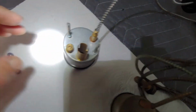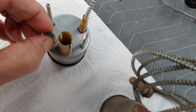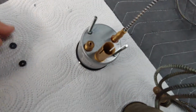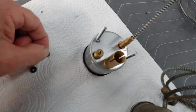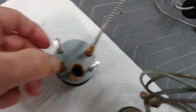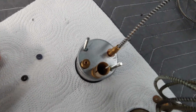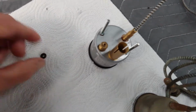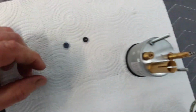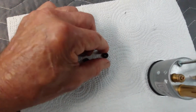So what happens, and what happened to even Mike Bincoli, is in using this new replacement leather washer, he put it all together, and some of the leather got chunked off and into here against the screen and blocked it up, and his oil pressure gauge wasn't working right. It couldn't get the flow. So I gave him my last NOS correct size one, and decided we need to figure out how to fix this imperfection ourselves, because it's what we probably got to deal with.